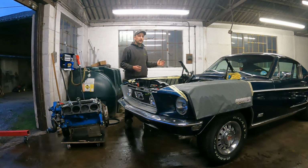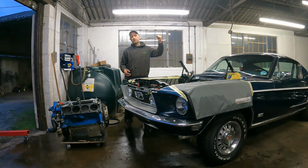And because the head is all okay and all the valve stem seals are okay, what we think has happened is because there was such a vacuum in the chamber that was pulling oil up through the rings and then out the exhaust. Because we can't find any signs of ring failure, any signs of valve stem seals. So as the piston was coming down, the inlet valve was stuck, it was creating a huge vacuum. The oil was coming up through the rings and then pumping it out the exhaust.